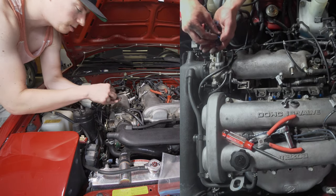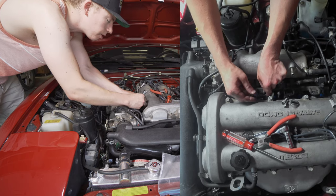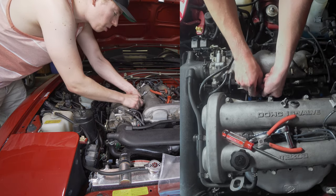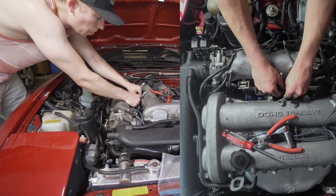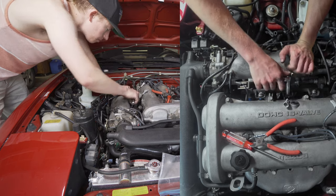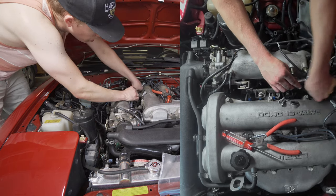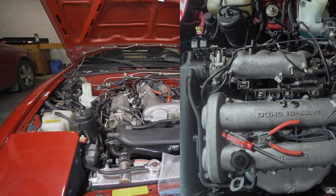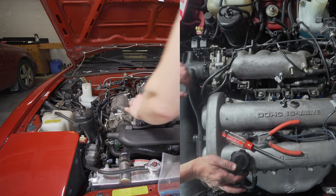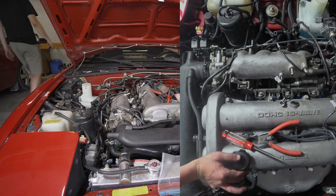Because of the height of these injectors, you add these spacers — these washers — to space out the fuel rail a little further. Then plug everything back in and we will do a leak-down test with the diagnostic pin. We'll show you that in a second.